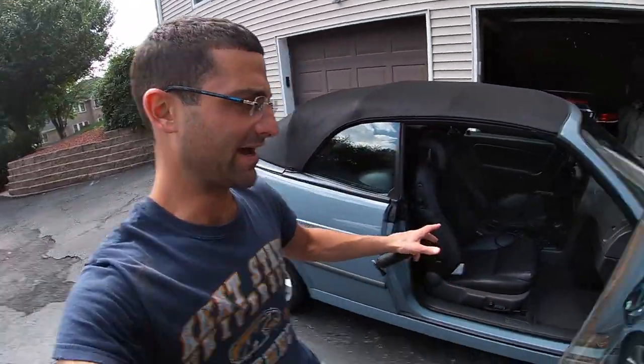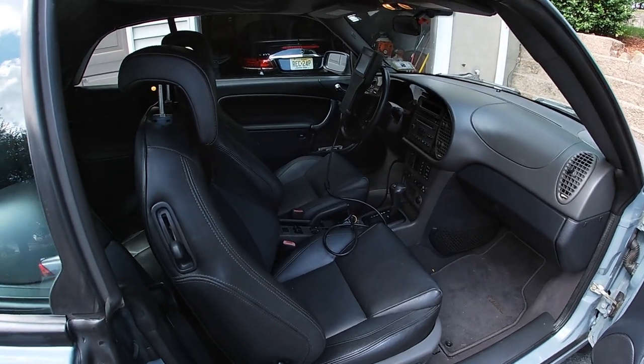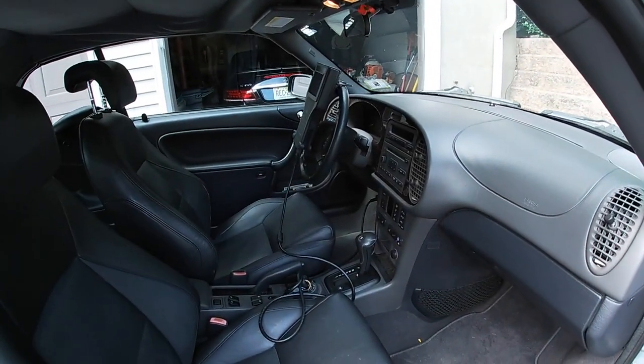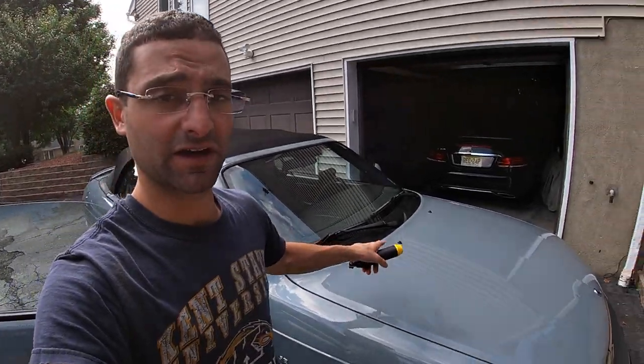All right guys, we are back from the drive. Did another round of testing, as you can see with the Tech 2 up there, and the fuel tank pressure still looked normal. So I think based on the performance of the vehicle, how it was riding compared to how it was previously, knowing that we fixed and sealed off that one last leaky vacuum line to the throttle body, I think we may have fixed our problem.